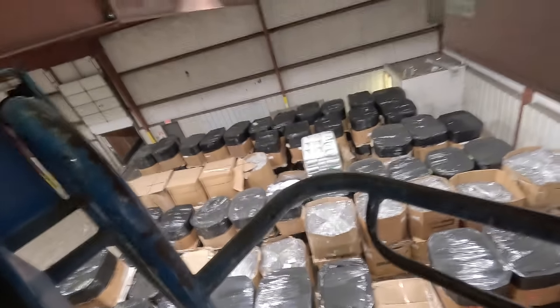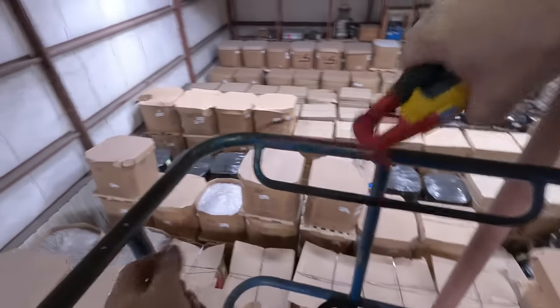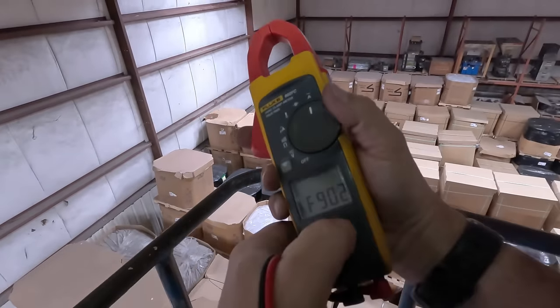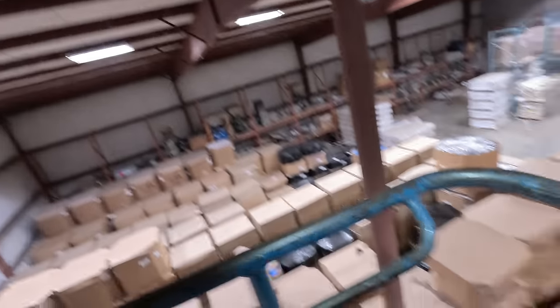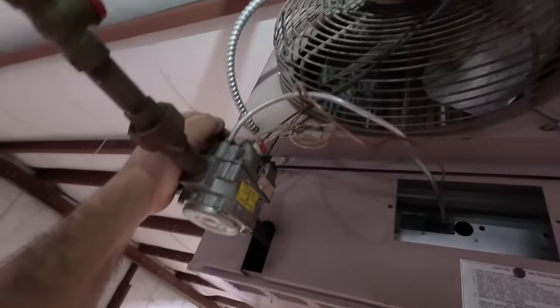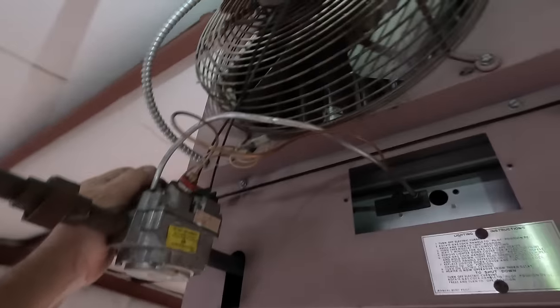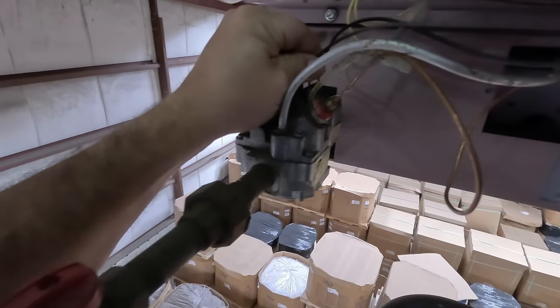Let's turn it on and see what happens - let's see if we've got power on that transformer. I've got power on it - transformer's live. I'll jump this out and bypass it. There's a limit switch there in line with the thermocouple. Gas valve's got power to it but nothing's happening. Let's unhook one of these and see if it doesn't click.